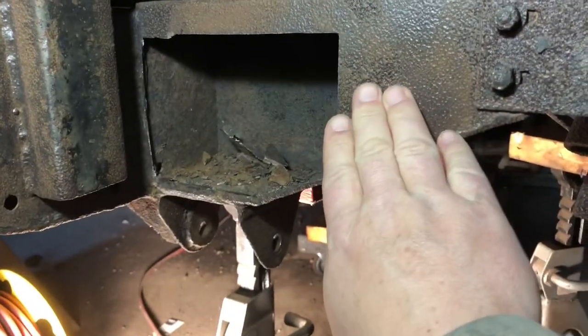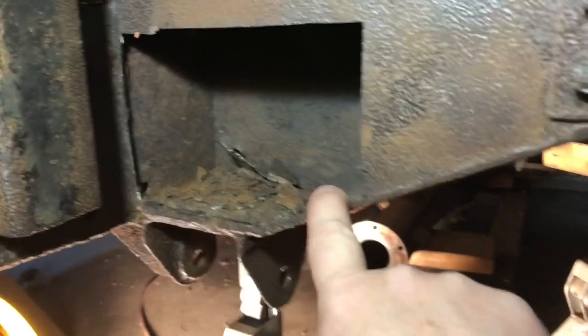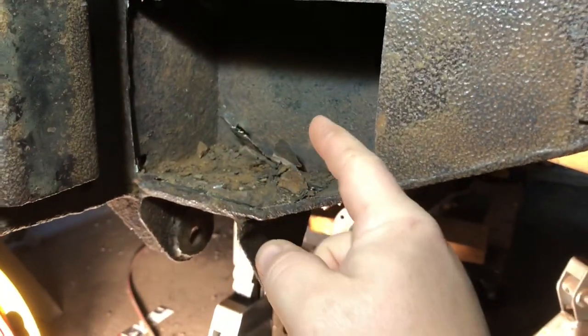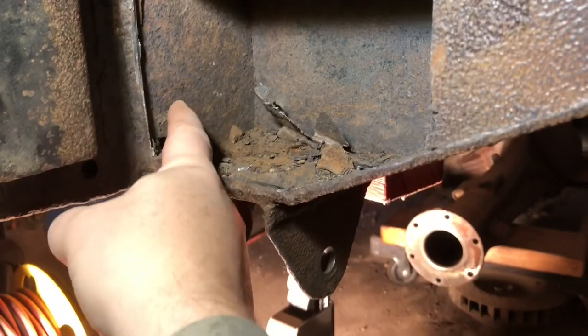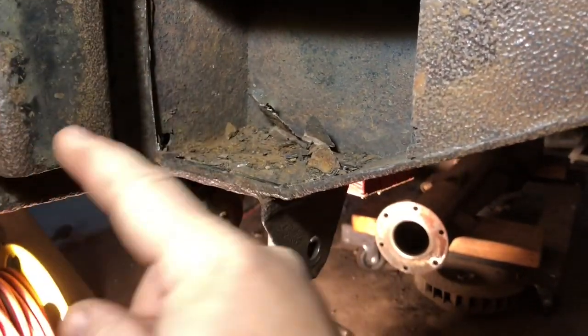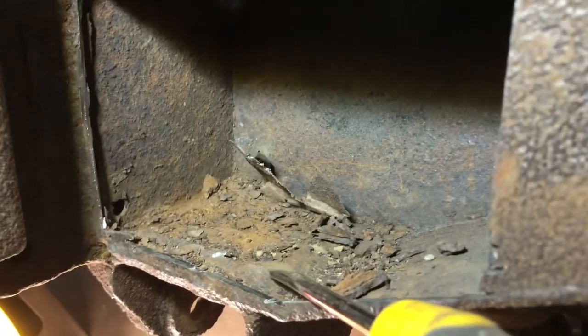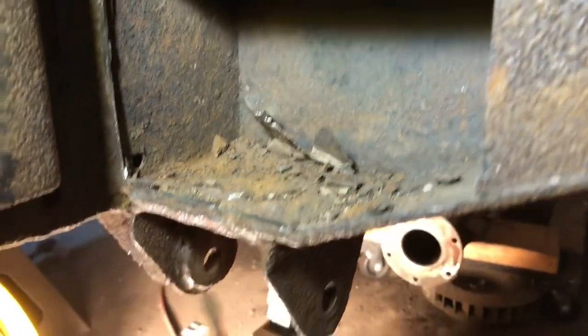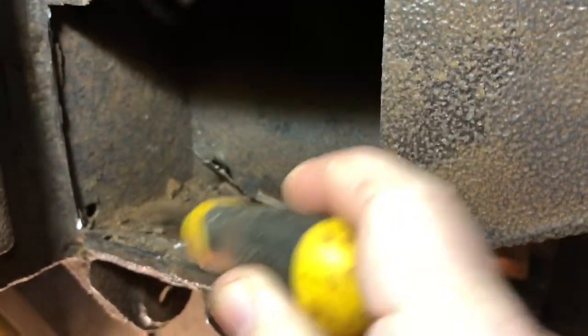This is the passenger side outrigger. While the other side is drying from the Core Seal, I cut this side open to see what's going on. Just like the other side, it had a nest all inside here, but it wasn't as rusted in this part — this is still solid up and over on this side. The weird part is this side has the exact same problem. Down in there, this second plate that was welded on is all rusted away on top of the shackle holder plate.